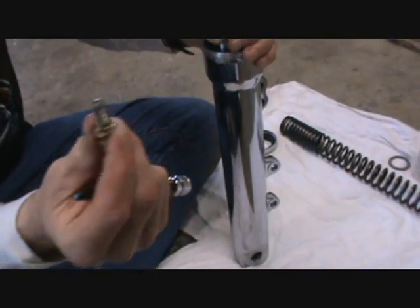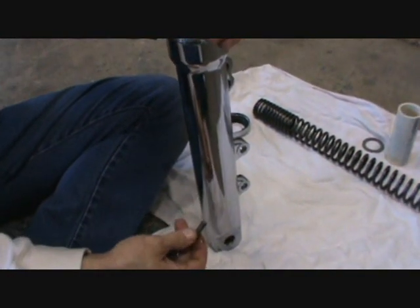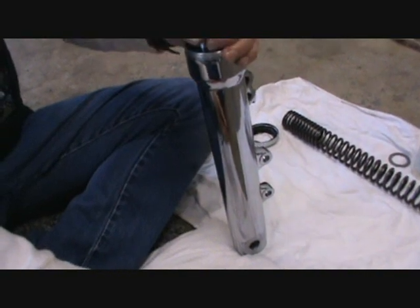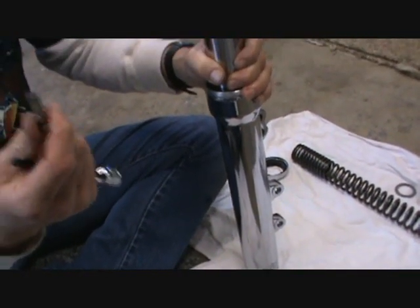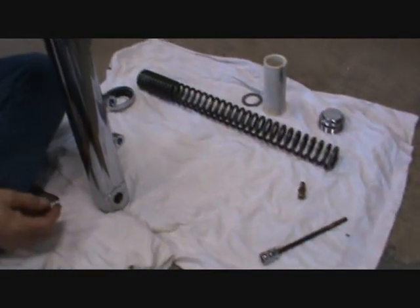Be careful because there's a little brass washer that goes on here — that's your seal. If when you put this back together you don't torque it, it's going to leak and then you're going to be pulling everything apart again to fix it. And when you take this out, all your oil is going to drain out. So I'm going to set that off to the side.